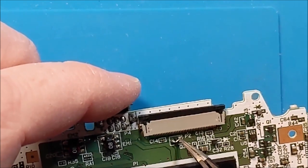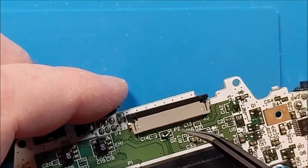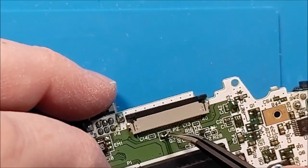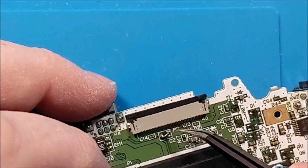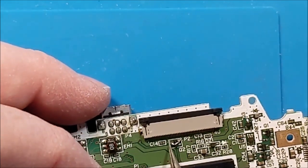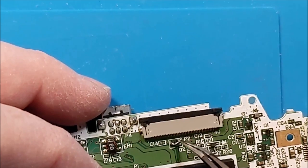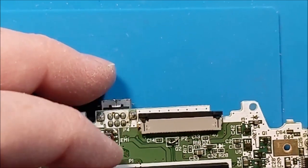Now, I may need to actually just double check that I soldered properly on that anyways, because I might not have an actual full connection. I might have a dry joint there. So you connect this primary one, there's only one output here, and you connect it to the one up here because there's two points. So I actually laid a little piece of wire across and joined them, but I think I need to add a little bit of solder to this piece here. So